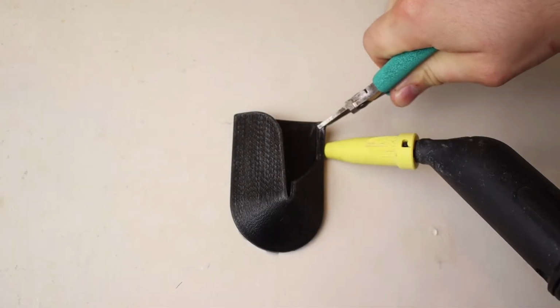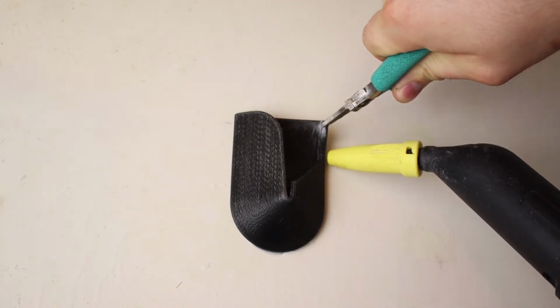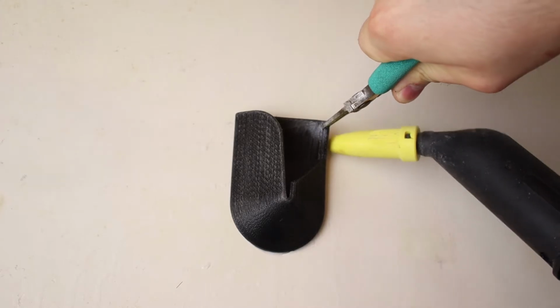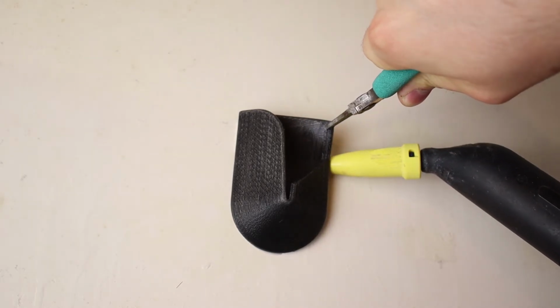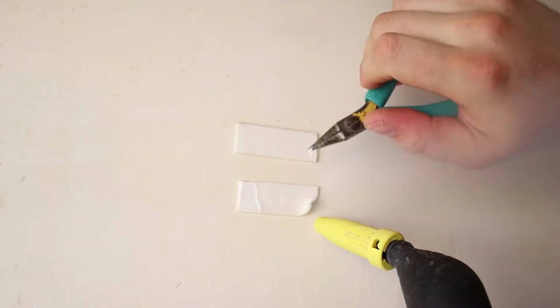Joking aside, using a steam cleaner might look extremely stupid, but actually due to the high pressure steam trying to push apart the glue joint itself, it's possible to remove the double-sided tape leaving minimal to no residue.